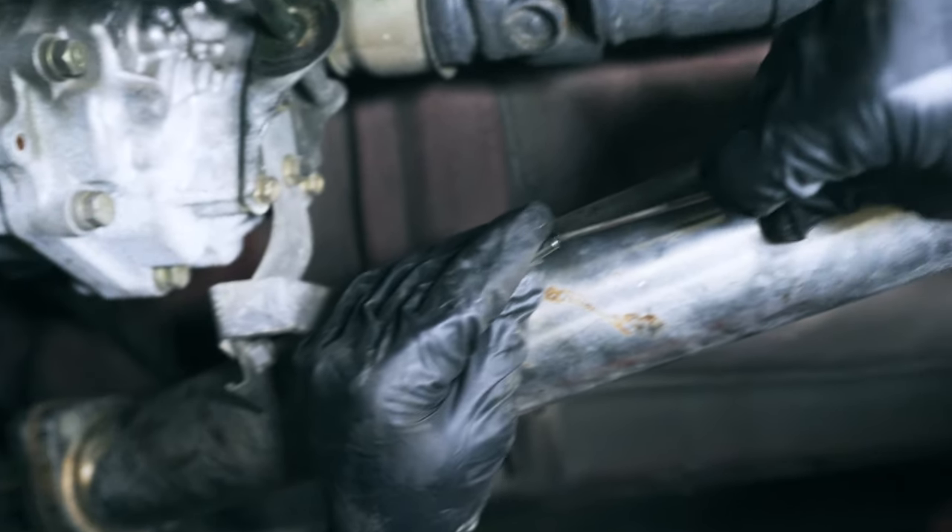So then we have the two mounts here. This is the exact same match — they just add a lot more material. Look at the difference. This one's actually not bad, but you can see how much it flexes — it's got quite a bit of movement. This one, not so much. That's like a solid mount, but it's definitely not solid because solid makes everything shake. So this is still rubber — just a harder, denser rubber. These are the inserts for the transmission subframe — they're just real thin but they're urethane. They go right here. Your five-speed mount sits right here. It's going to be really, really solid. The shifts are going to fall right into gear — the transmission is going to stay put.